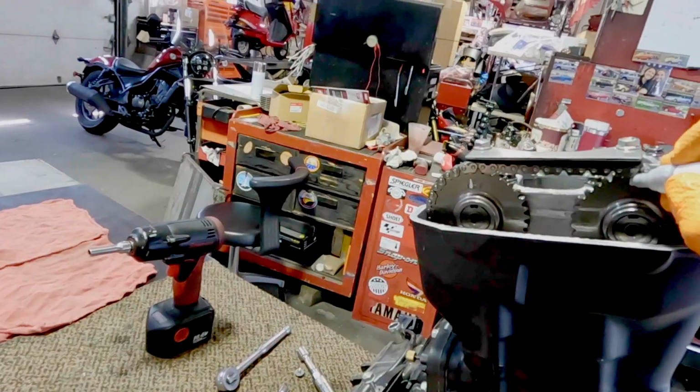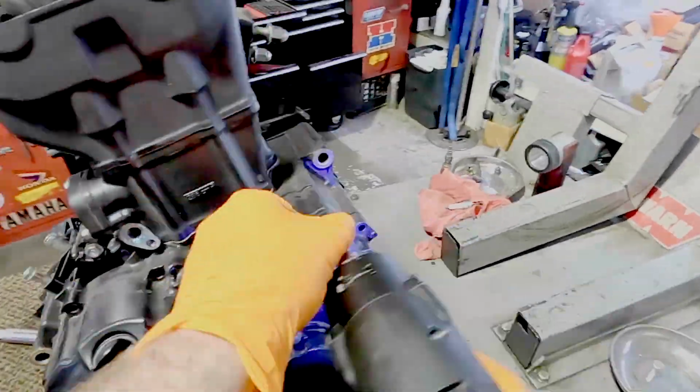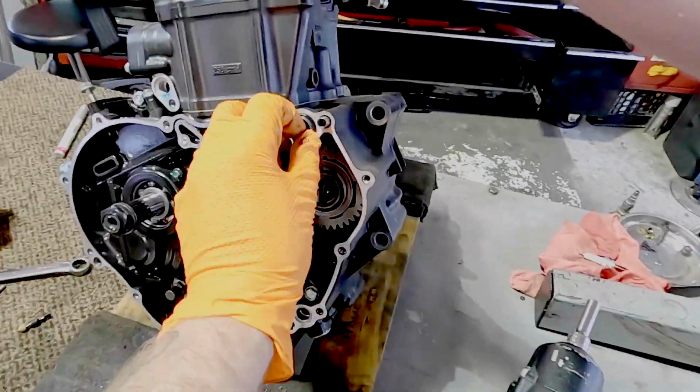Like right there, I had to put a spacer on that stator shaft so I can spin the motor through. Want to get the motor pretty much at top dead center compression. It's a lot less stress on the cams when you go to remove them, and a lot of the stuff is already loosened or taken out of the bike before the motor comes out. It's just so much easier.